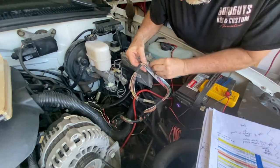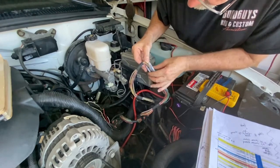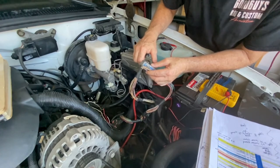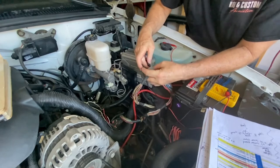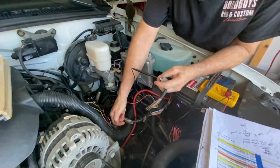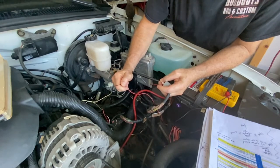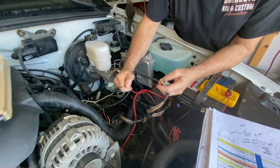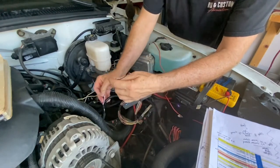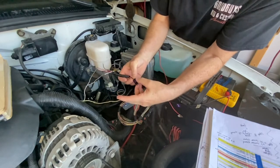Number 74 doesn't have an actual number visible on it because it's right behind a clip — you can see number 76 right here. So the yellow wire is number 74, and that would be our signal. Now let's find which of these wires is the correct one for it. There it is — you can hear that audible tone which tells me there's continuity, and that's the correct wire.